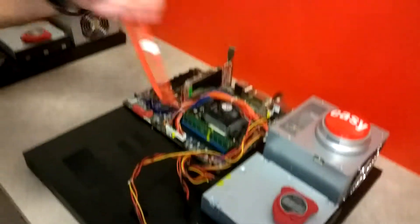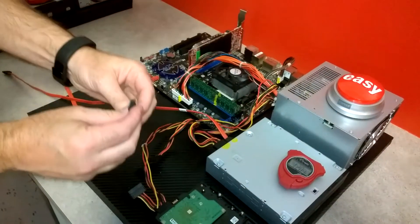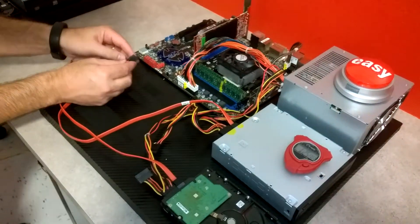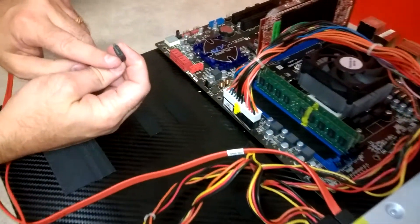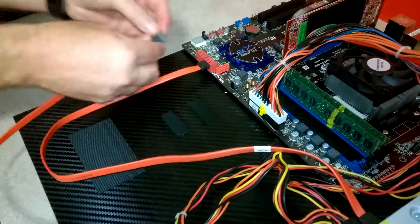Then you've got your data cables for both of those. I'm going to first plug in the DVD, then plug in the hard drive. I'm going to come over here and plug them into any of these ports — there are tiny little notches that have to line up. I'm going to plug one in there, and one in here.